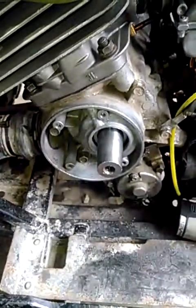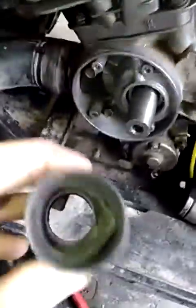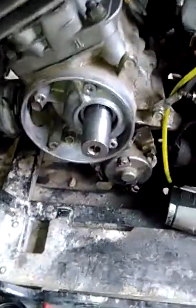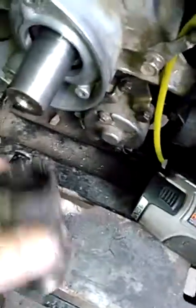There was a little seal groove in there — it's almost gone now. There are quite a few other marks but it's starting to feel pretty smooth. I'll get a pick and put it in there to make sure I can't feel any ridges. When you put your crank seals back in, find a socket that's the same size as your seal and drive it in evenly. Make sure you drive it in even — this is a Polaris 250 2-stroke. You want to find a cylinder just a little bit bigger than the crankshaft, put emery cloth inside, and work it in. Drive the seal flush with the case.